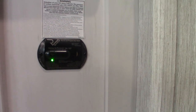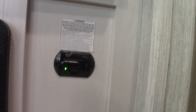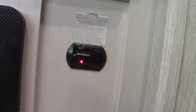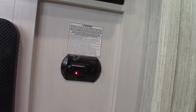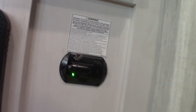This is your carbon monoxide and LP gas detector. It should always be green. If it goes off, it's detected a carbon monoxide buildup or LP gas. Also, if it starts beeping very slowly with the same tone, it's telling you the battery is low. LP is good, carbon monoxide comes up, and then the low battery alarm. It should always be green — if it's not, get it serviced. It's important.